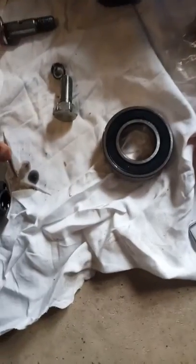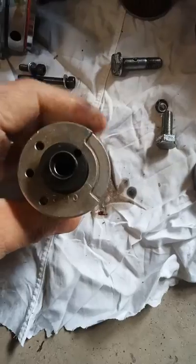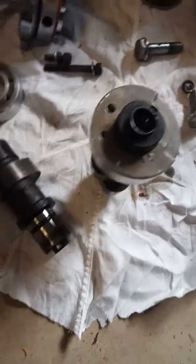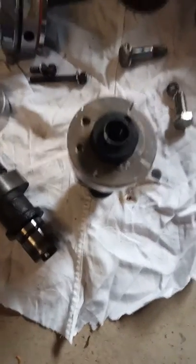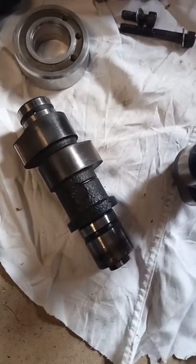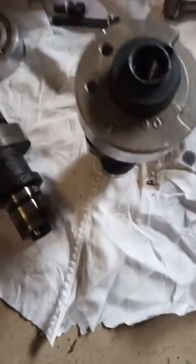I've ordered two cams — there was only one cam broken, but I ordered two because I'm getting them second-hand out of an engine. I thought, if someone changed the cam or it's a different profile and I only order one, I'd end up with two different grinds and the engine wouldn't run properly. I got the two cams out of the one engine, and they came from the US.